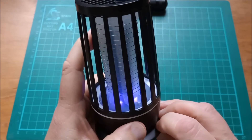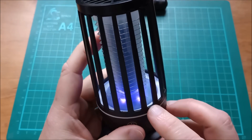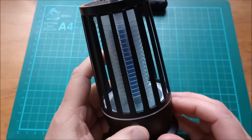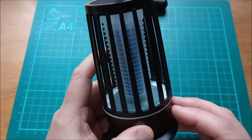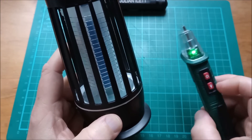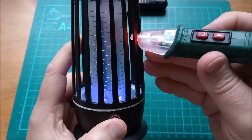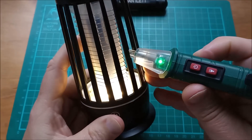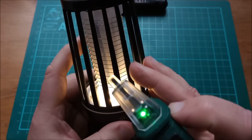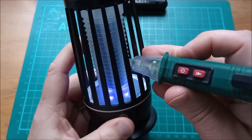Let's switch it on. You've got the mode with purple — certainly ultraviolet — LEDs, then this mode which switches to white LEDs so it's just a kind of lantern, and then off. Now let's look at when the high voltage system is switched on. I've got this non-contact voltage detector, and when I switch on the UV you can see it's detecting high voltage there. When I switch on just the white lights that goes away, so the high voltage — about three kilovolts — electrocution wires are only on when you've got the ultraviolet light on.